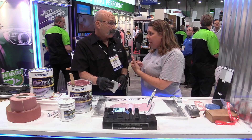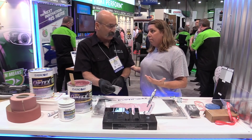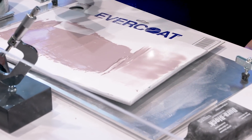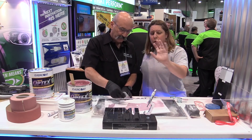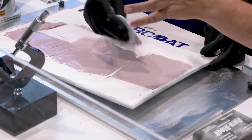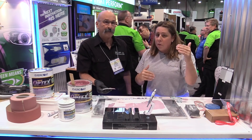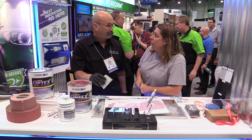With the echo resin technology, pinholes really aren't an issue as long as I do my right mixing, use the right hardener ratio, and don't rapid cure. This first application is basically just a very thin, tight skim coat. We have two OEMs that require laying down an epoxy before putting on filler, so always put your epoxy down first. But if you're going direct to metal, that very tight skim coat gets into all your metalwork and prevents corrosion from going under your repair — so that skim coat is really important for adhesion and pinhole reduction.